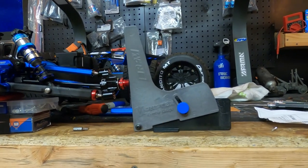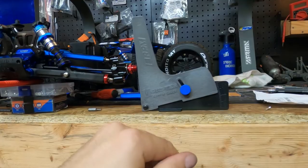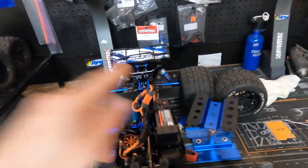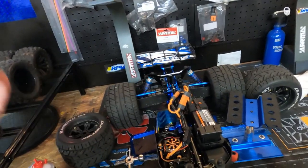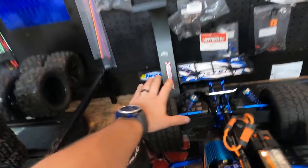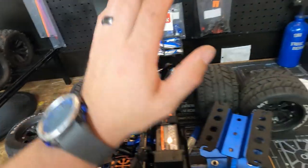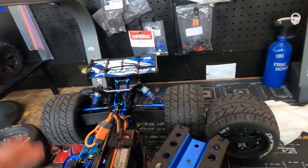Cornering would be really good for this setup — you want the tires to be kind of jacked in when you're doing cornering so that when you turn them, the front nose of the car will dive into the turn. The only problem with that setup is that the back tires will then break loose and slide away. You don't want that. You also don't want that negative in the back — and see, this gauge works for both the front and the back.